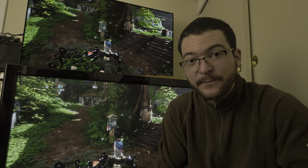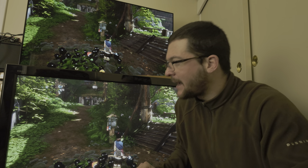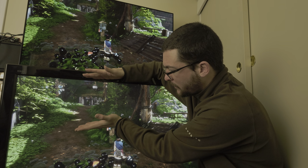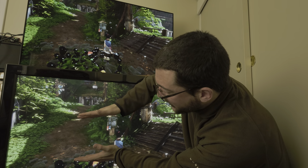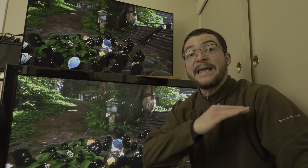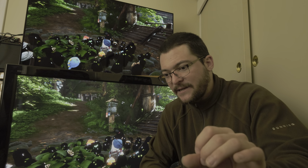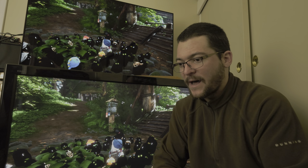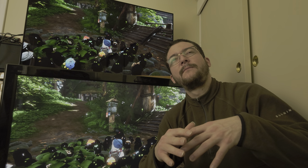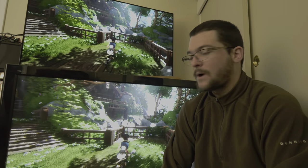When you use OLED Motion Pro High, the pixel visibility time — the persistence — is reduced to 38% based on my testing. What happens is the LG C1 draws the picture left to right, top to bottom, and once it has drawn 38% of the screen it scrolls that down with the rest being black, reducing persistence and improving motion clarity. At 60Hz the sample-and-hold persistence is 16.6 milliseconds; 38% of that gives you the effective motion clarity — basically equivalent to 158 FPS. The plasma TV is like 240 FPS equivalent based on persistence.